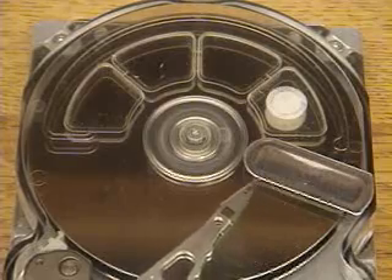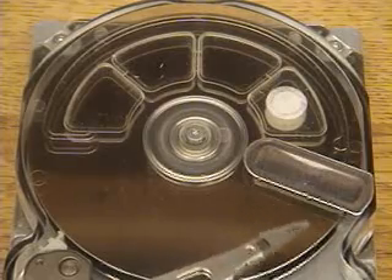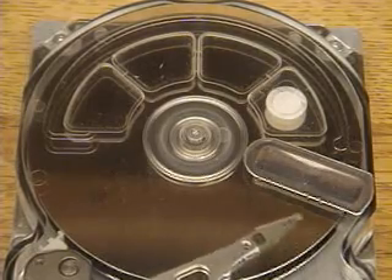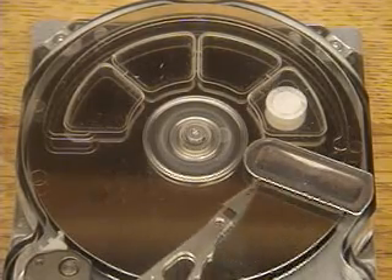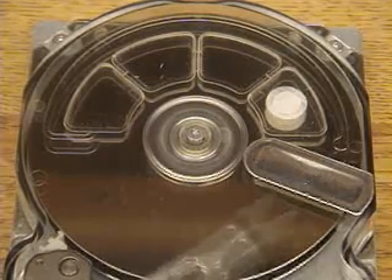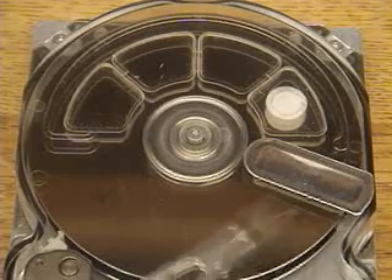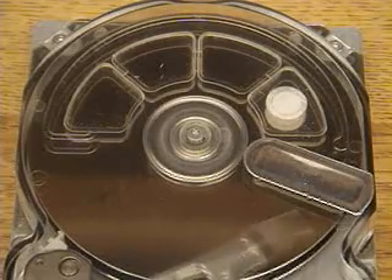You can see as it does this motion it looks kind of continuous but it's not. It's actually moving from one specific track to another — jumping, I think we're up to 32 or 64 tracks at a time on each sweep. Now it's actually moving half its full distance per given seek, moving to three specific locations, locking on, and then moving back.